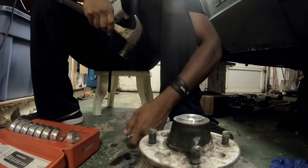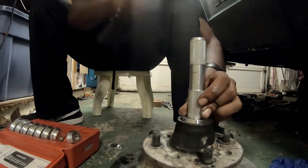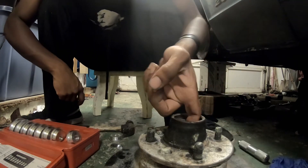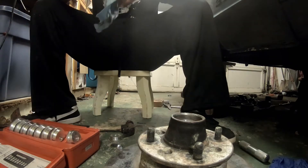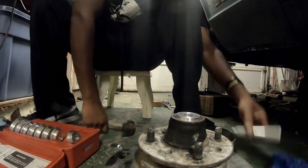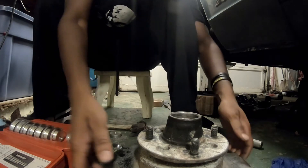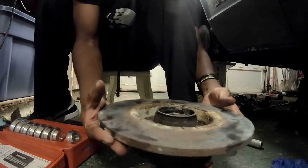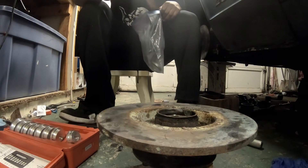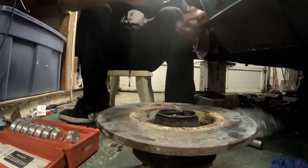Test it all the way around — if you have fingernails — and once you have that seal all the way around, give it a few more hits and you'll be good. That sounds like we've made it all the way to the bottom. I'm putting this inside here and we're gonna hammer this down really hard. Testing with my fingernail, I cannot feel any openings, so that means our front race is already done. I'll give it a few more just to be safe.